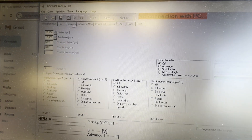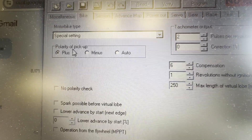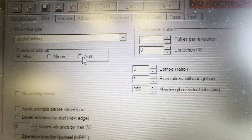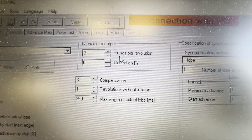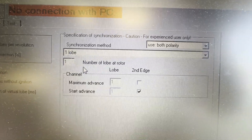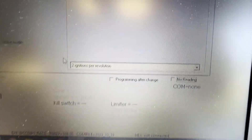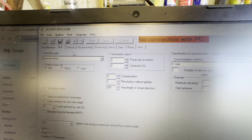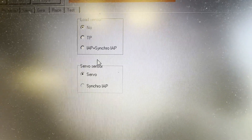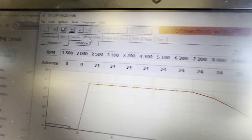The second advance chart is 13 to 7, 30 and a half thousand. On the bike settings we've put it on special setting and the polarity pickup we've put on plus - some people have been putting it on auto but we've gone to plus. The tacho meter output is two pulses per revolution for this bike. We're running on one lobe on the synchronized method, and we've also done two ignitions per revolution. On the sensors we've put no for the load sensor, but for the servo motor we've ticked servo because it has the power valve.